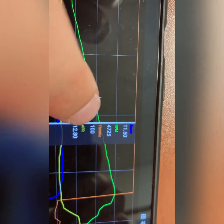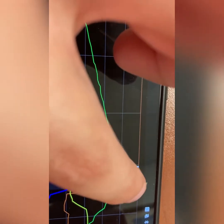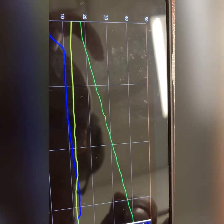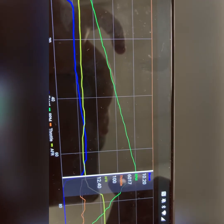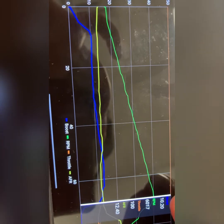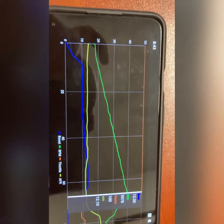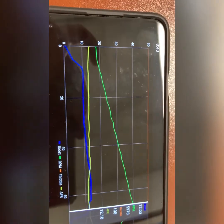A little bit higher at 4,700 RPM, 11.5 pounds of boost, 12.8 AFR. Moving all the way up to the top — at 5,600 RPM, 13.3 pounds of boost, 11.7 AFR — that's perfect. Towards the very end of the band we've got 12.5 AFR at 6,000 RPM, then 10 pounds of boost as we're letting off. The 12 to 12.5 AFR at the end — that's really safe. The air fuel ratio looks great for map zero, which is completely stock.